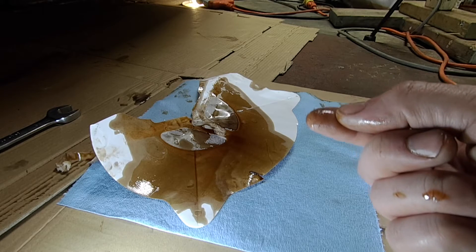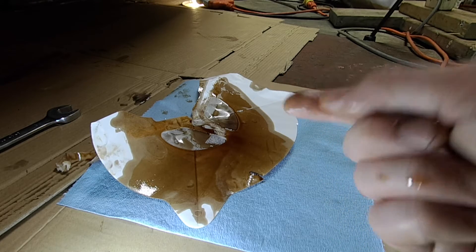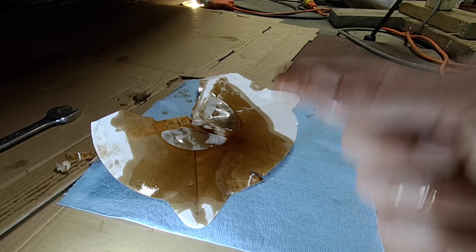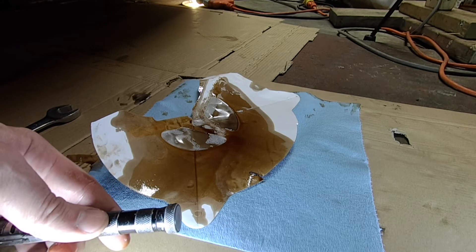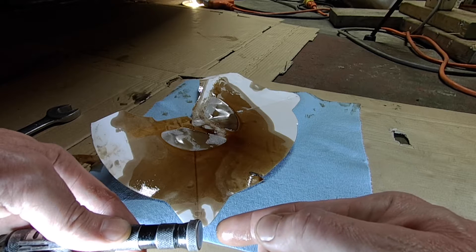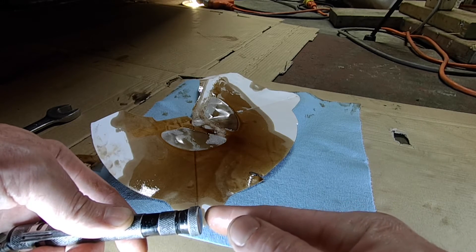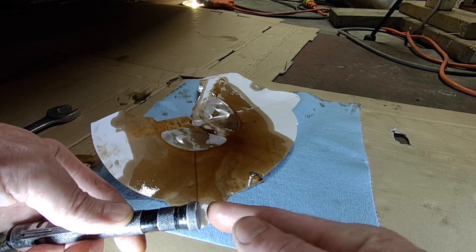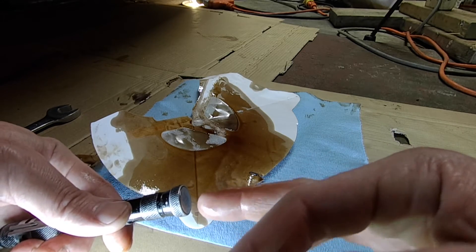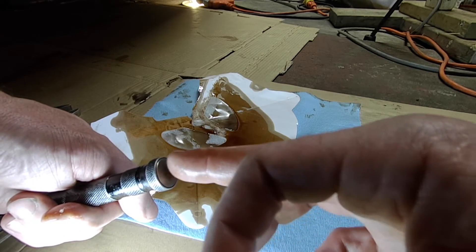It is definitely metal. I did notice that somebody just changed the drain plug and put an oversized one in, so maybe these are aluminum bits. I'm going to get a magnet here and just see if these stick to it. I've got a relatively clean magnet and I'm going to see if the pieces come off my finger and go onto it, because if they don't, then they're aluminum and it's not an issue. You can see most of them are still on my finger — only one transferred, so the rest are all aluminum. There was only one tiny fleck of steel in all that, and it's pretty tiny.